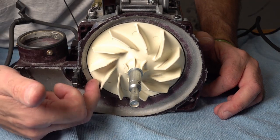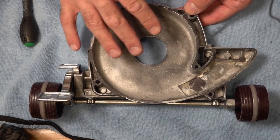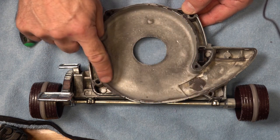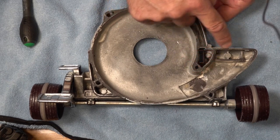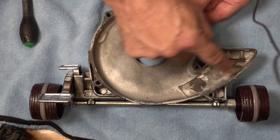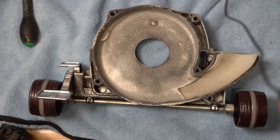When taking this off, do not prise it underneath or you will damage the inside or warp the plate. With your front plate, give it a big clean while you've got it off. Then run a bead of silicone all the way around here, around here, and here — just a blob to hold things in place. Then slot that in and it's ready to fit to the Kirby.